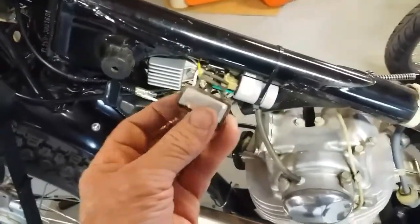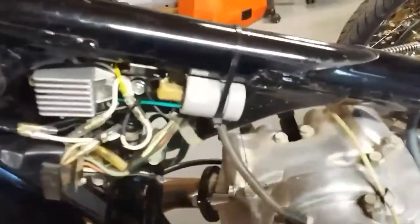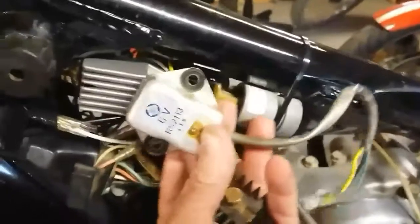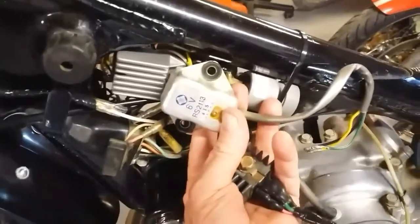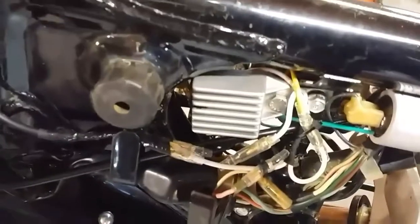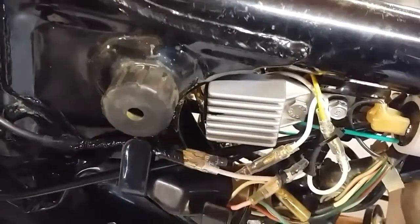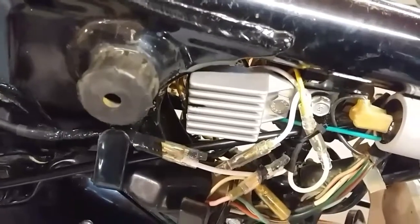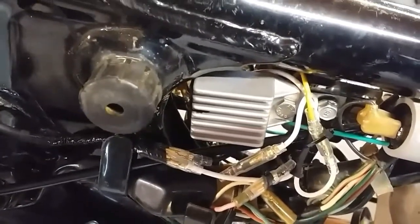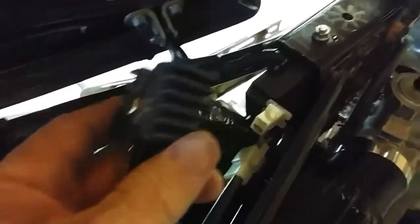Here's a quick look at what I've replaced. This is the original relay, which blinked very slowly. The Pardue Brothers flasher is the replacement. This is the original DC voltage regulator that fit right underneath here. Because the bike had been run without a battery, I was told it was toast, and everything I read confirmed it wasn't very good in the first place — it had no regulator for the AC voltage going directly to the headlight. This new one, made in Taiwan and purchased through the UK, is designed to fix that and keep the light less flickery.